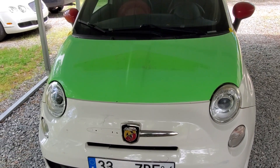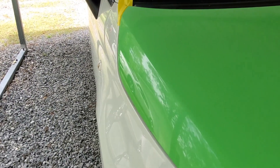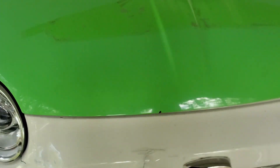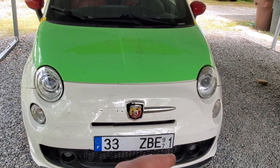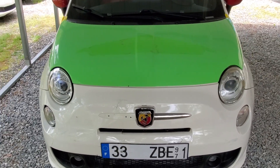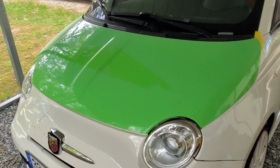The hood is on and as you can see it lines up pretty decently. These things weren't perfect from the factory anyway, but it lines up pretty good on both sides. The gaps all look pretty good, and up front we're going to replace that bumper cover which will straighten some of that out. We can make adjustments and put shims in, and around the headlights it even looks good. Now we're going to take the hood off, clean it well, and get that decal residue off — this was off a company car — then start prepping it for paint.